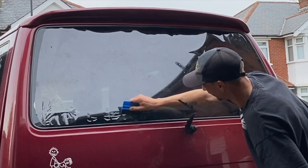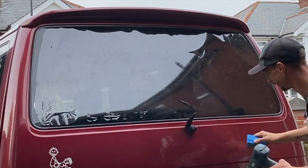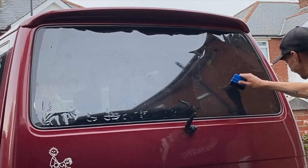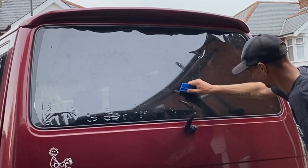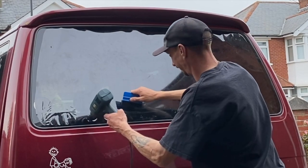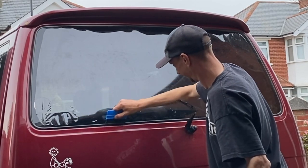Again, you can see I'm applying heat to it to watch it shrink, and then I'm pushing those shrink marks. Where it shrunk, I'm then pushing that out. And I'm not getting too carried away with the heat, because it's very easy to get carried away and just overheat it,